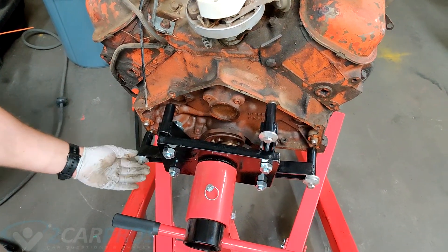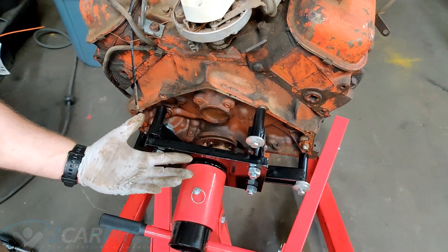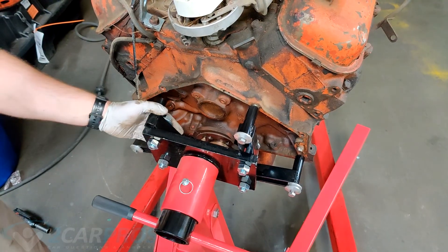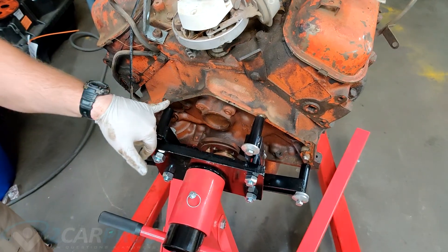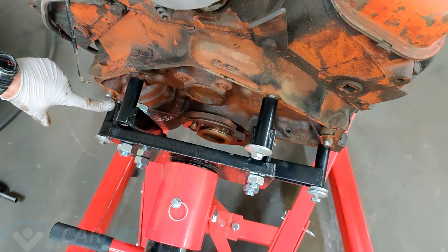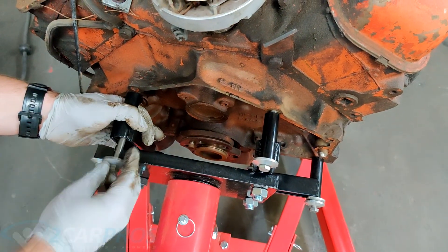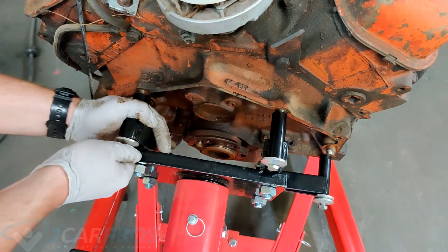That's what actually holds it on here with some pretty heavy-duty washers, because this thing weighs about 600 pounds. You don't want it just clawing its way through these little cheap metal fittings. Leave these fittings a little bit loose so you can adjust them, and just line it up so you get one into each of the four positions. Do not relieve tension off the crane until all of the bolts are in and tight. Use four out of four — do not try to use two or three out of four.